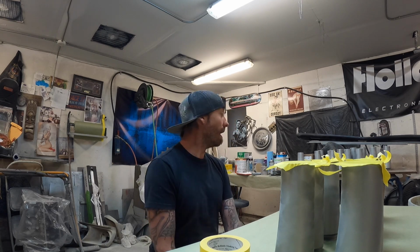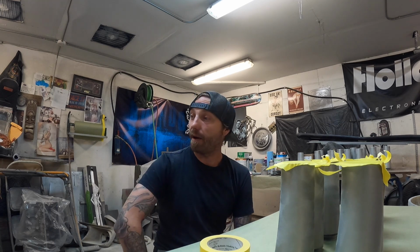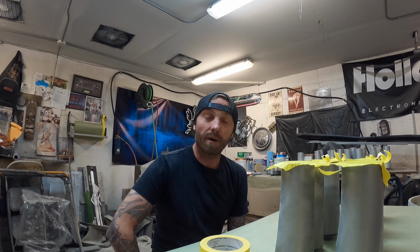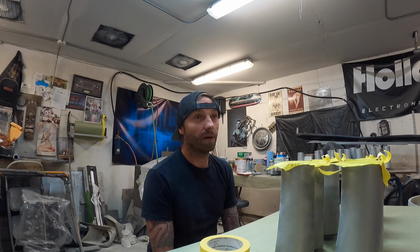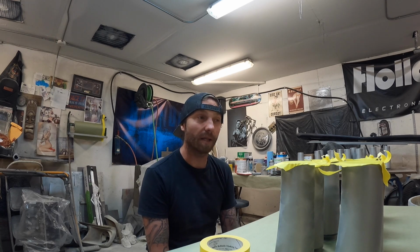So, update on that besides the paint. I have most of the pieces to put the short block together. I'm going to put studs in the bottom end on it because it's an aluminum block. And then I figure at this point we're already there, so we'll stud the bottom end and put that all together. I need head gaskets and normal gaskets to put the thing back together.